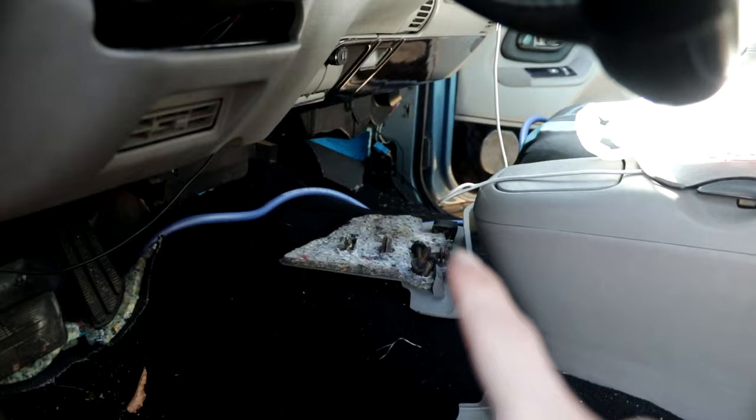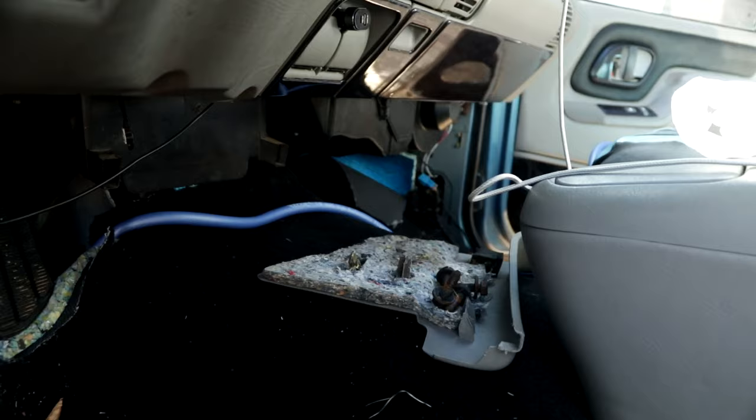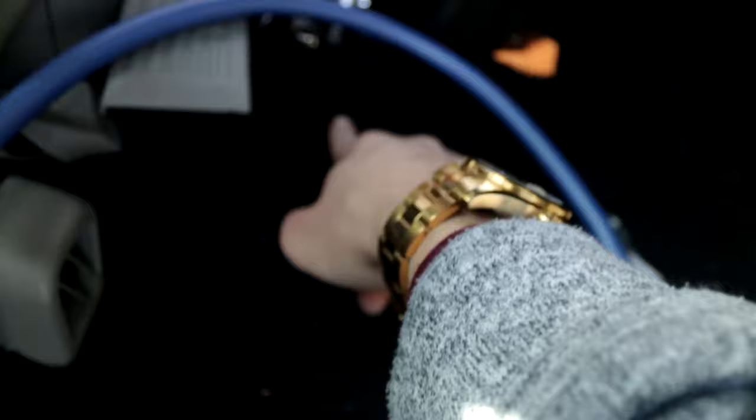In these GMT 400s there are no firewall holes to run wires through, so you will need to drill one. We're going to drill over here in the passenger side footwell so it's on the side of the battery. I've got my power cable coming up and around here. It's going to go under the carpet and we're going to run it straight beside the seat down through here where it won't be felt through the carpet where we got padding, down where our amps will be. Power cable is ran under the carpet.